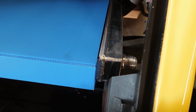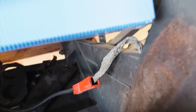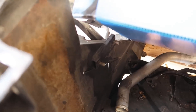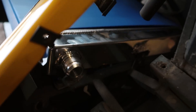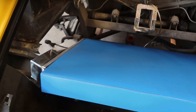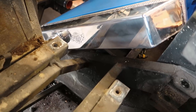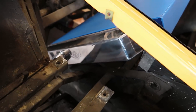It's just sitting in here for now and the biggest thing up front is that we're gonna have to clear some of this sheet metal here so it can actually lay on the frame rails. We've also got stuff on the frame rails we've got to get off because it's gonna collide with those. What's really cool is that this mount here used to be for a battery quick disconnect, so it's flush with the outside of the frame rail. Essentially the edge of the end tank is perfectly in line with the frame rail, so we can make some really simple tabs coming off the end tank to mount it to the chassis. It's the exact same situation on the other side — these things are just perfectly in line with each other down to the fraction of an inch. Once we square the radiator up a little bit, it'll fit even better.